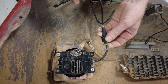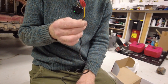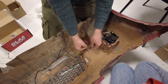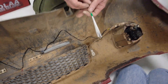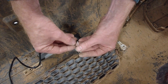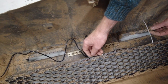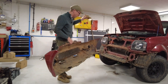That clips there and it's all waterproof. We'll route that, and then this wire we've got left we're going to take up to the fuse box in the car and pick up a 12-volt signal that comes live when we turn the car on, to power the DRLs. We've got this one all plugged in — the pack includes cable ties, so we're cable tying it up to the other cable here and across the front so it doesn't get in the way. We'll run that all the way along, and everything is neat and tidy. We've just got this wire left to route up to the fuse box.